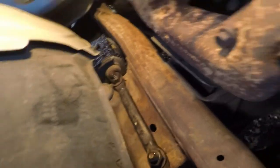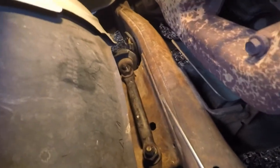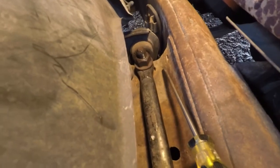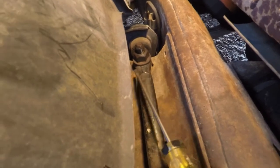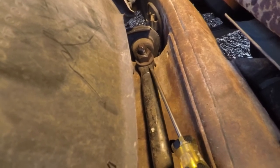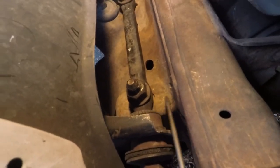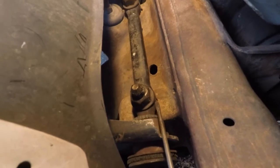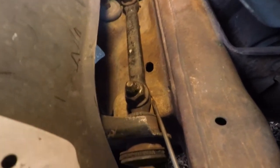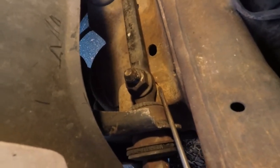On this vehicle, this is where I can adjust both camber and caster. Basically I want to move the front part of the top of the wheel out about an eighth of an inch. Down here I'll also move it out an equal distance — an eighth of an inch — to maintain the same caster. You can see it's a little smaller opening compared to the back.